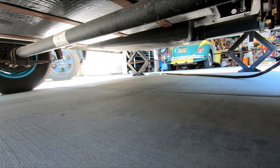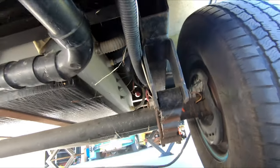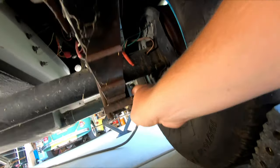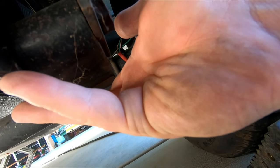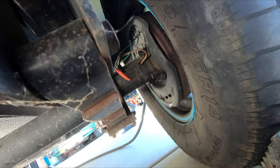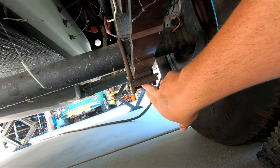You'd have to take it to somebody and get it straightened back out. Ideally you would want to jack up on the frame, but you can see my frame here is covered with pipes, so that won't work. Instead, what I'm going to do is get under this U-bolt cover here — this is going to be my jacking point. I could jack right here, but the base plate of my jack would probably put too much pressure on the leaf spring when everything tries to drop down.